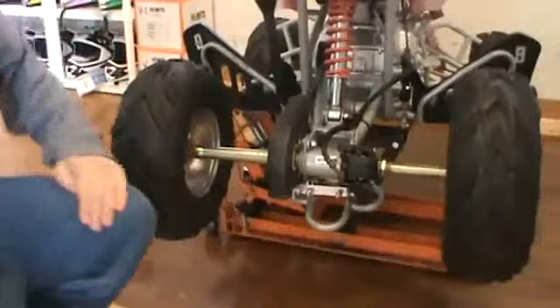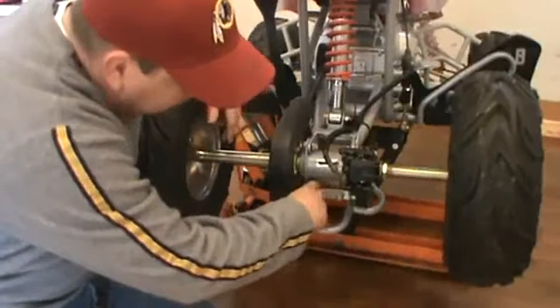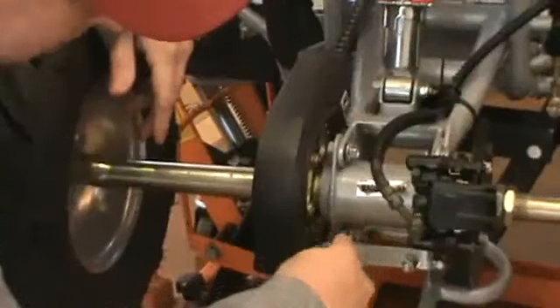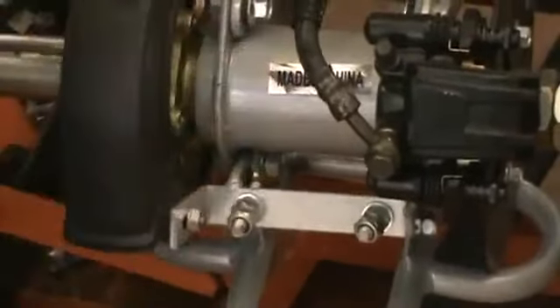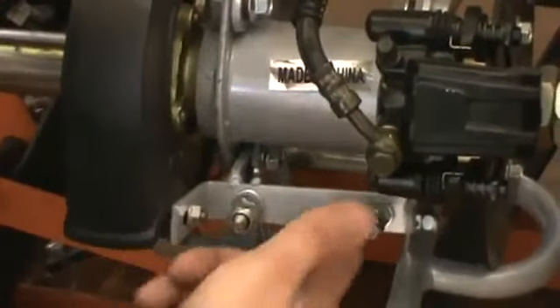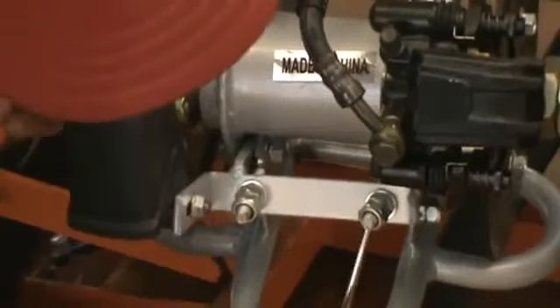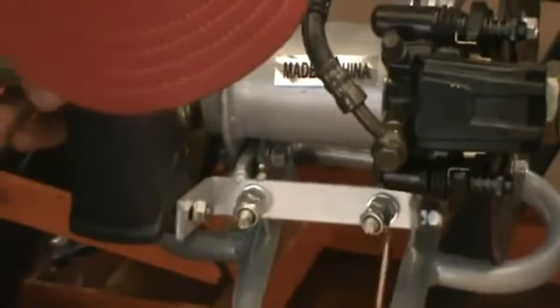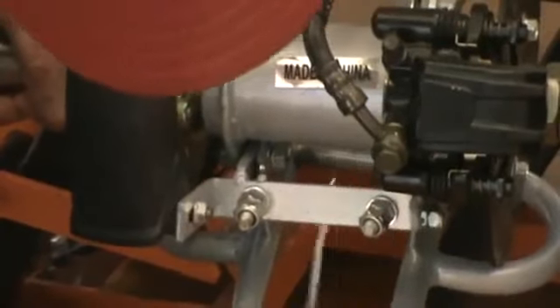On all your four-wheelers, it's going to have two eyelets back here in the back. If you look down here, you see these threaded bolts coming out, and on the inside there's eyelets — just two little round eyelets with a bolted thread that comes through them. The first thing you want to do is loosen those two up in the back. Get them loose.